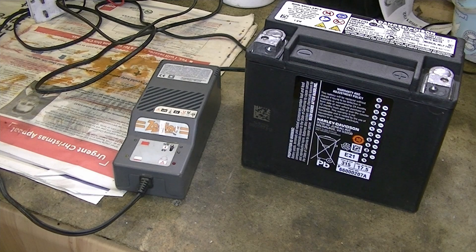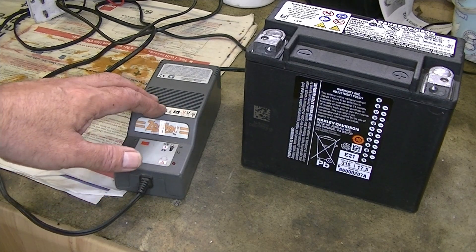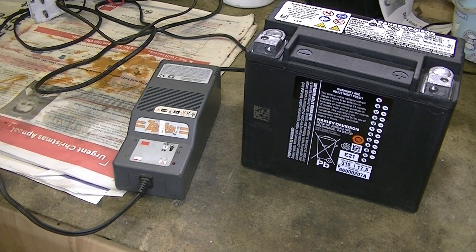When I finish riding the bike I bring it to the garage, park it up, and I always connect it to the trickle charger. It just stays on the trickle charger until next time I want to ride it, when I disconnect it and ride away. That's the only thing I can attribute the long life of the battery to - that it's been looked after on one of these battery tenders. These battery tenders aren't just battery chargers; they're not just charging the battery, they're looking after the health of the battery as well, and clearly this little toy does its job.